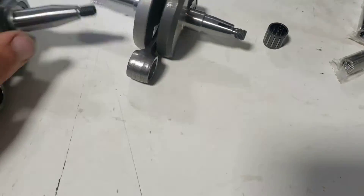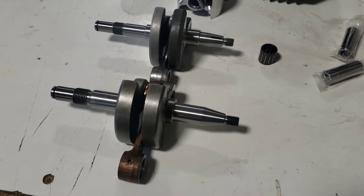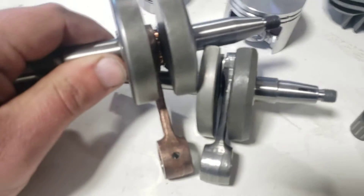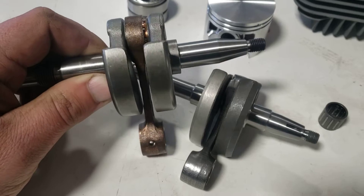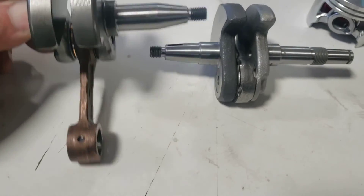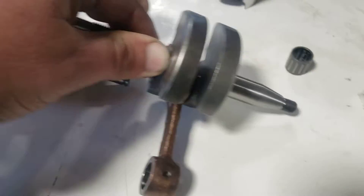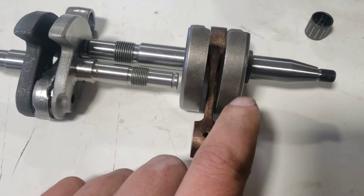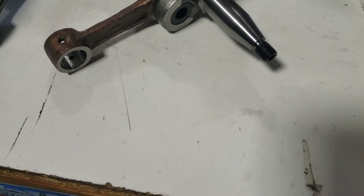Let's look at these close up. The Husqvarna crankshaft is a lot bigger — look at the meat, the mass, the thickness of the raw material. On the magneto side, just as a quick way to measure without a lot of tooling: the Husqvarna is longer on both sides, thicker, stouter. They both have the same stroke, so that's not in question, but the size difference could be part of why the Stihl bounces so much.